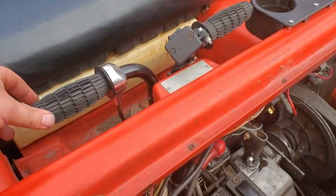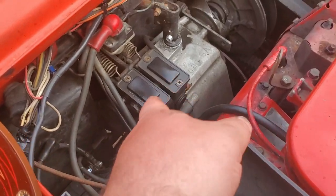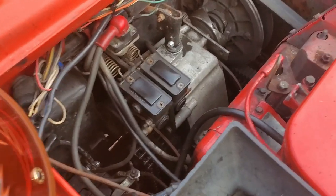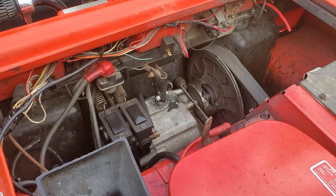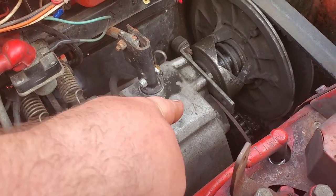We lost our brakes once today. This one, the right hand steer, but it still had brake fluid, except I can see pinholes in this cap. So my theory is it got vapor locked. We got a bubble in there or something, because after letting it sit for a few minutes, it came back. It's been working the rest of the day.